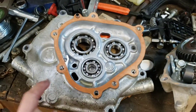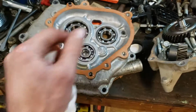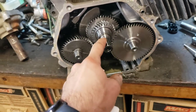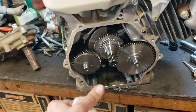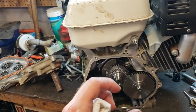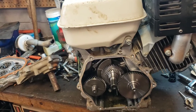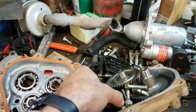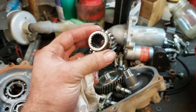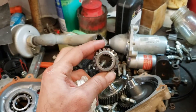You can see why this cover wasn't going to work - we've got no seal here, no seal here, and we've got some through holes that aren't so good. The only problem I foresee is this isn't a standard crankshaft sticking out; it's splined. So I need to look and see if it's possible to get a splined adapter of some sort to get us to a standard keyed crankshaft to attach our sprocket to, to run the log splitter. This is what came off of there - a little splined adapter to a gear - and I suppose I could have someone throw this on a lathe and turn that down, then cut a keyway in it.